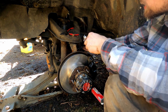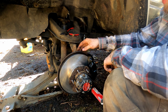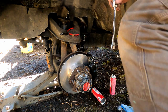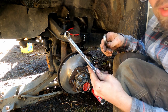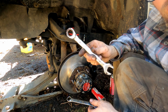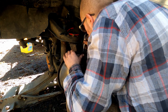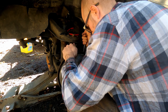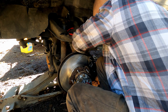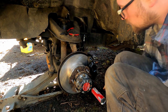Make sure the soft line isn't touching anything. I like having the part number visible so I can reference it if needed, though these are easy to find at any auto parts store — just tell them your year, make, and model. For the caliper bolts, they're 17 millimeter. I use the box end of a regular 17-millimeter wrench to loosen them because you often have to hit it with a hammer, then ratchet it off with a ratcheting box end once loose. Get those nice and tight.